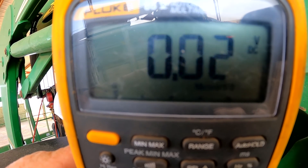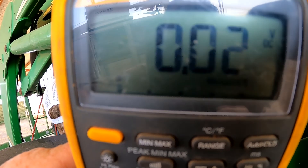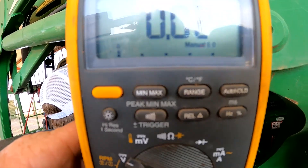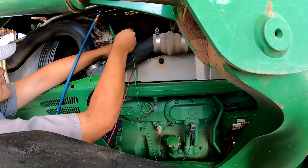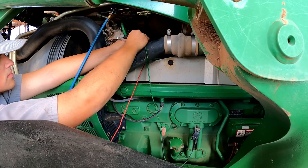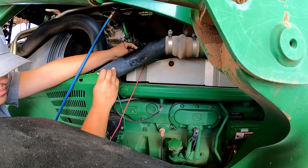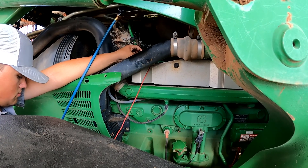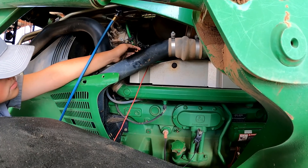We're going to backtrack and figure out why we're losing voltage. First thing we'll do is check voltage at the fuse on the fuse panel going down to the AC compressor to see if we're showing 12 volts. We're pretty confident we've got a wiring problem somewhere in the circuit between the cab power for the AC clutch and the clutch itself. We'll look that up in the schematic in a minute.